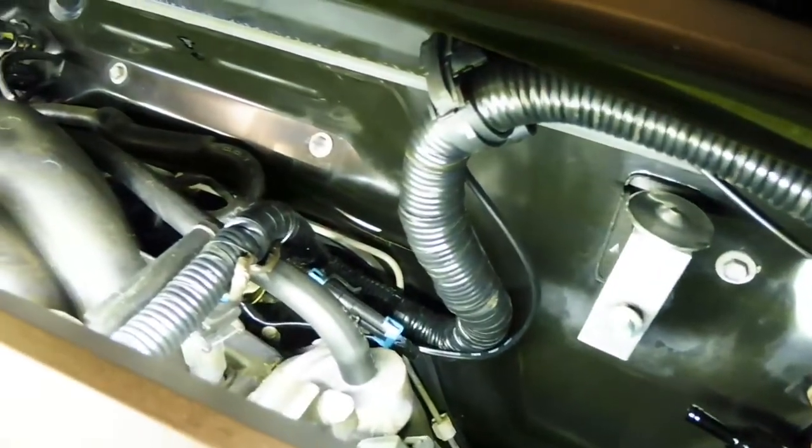Also in the back there is my oil pressure sender for the gauges in there, and I want to read oil pressure before I start it, so I had to prep up some wire and get that in. That's just roughly run for the time being. It'll go through that grommet over there. I've still got a vacuum line to put in for my boost gauge as well.